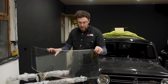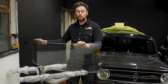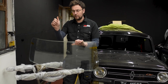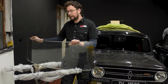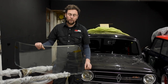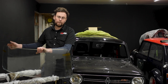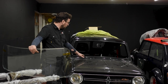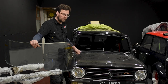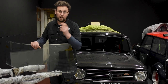There is no positive or negative — one side needs to go to earth and one needs to go to a switched live feed, which is live when you put the key to ignition position and flick your switch. You decide which side to earth and which side to put the live to. For me, I always earth the passenger side and make my switch connection on the driver's side. Simple reason: all of the electrics, the fuse board, and the hand controls are on the driver's side, so it makes it easier for running wiring. It's simply finding a body earth in the back of the dash, putting the terminal on the end, and earthing it through.